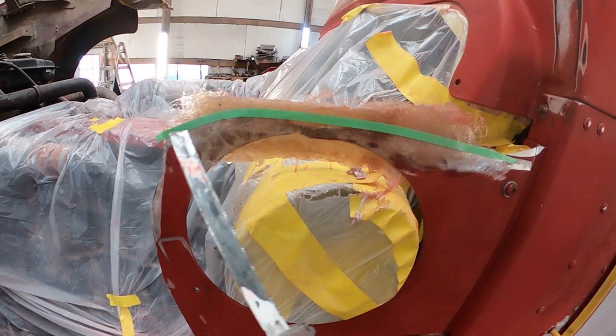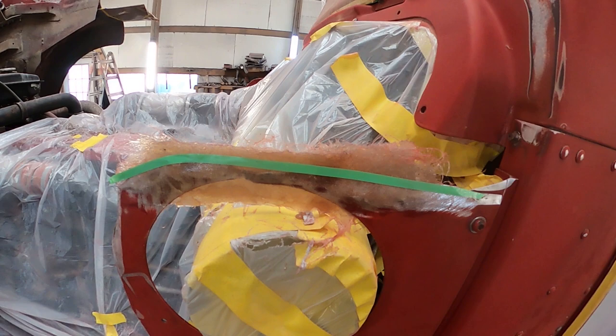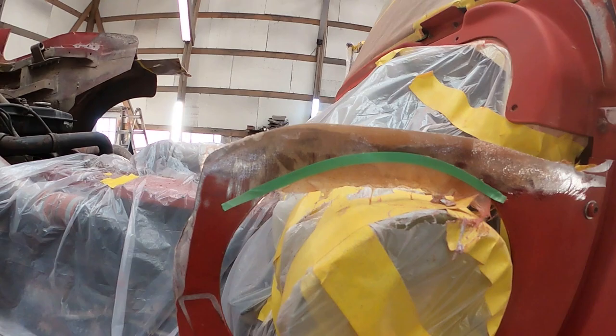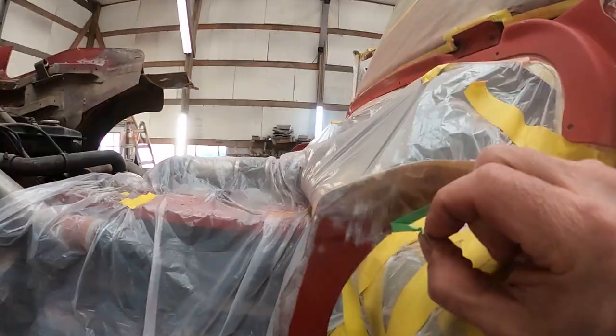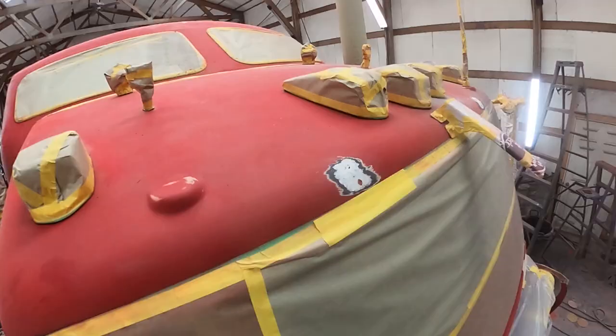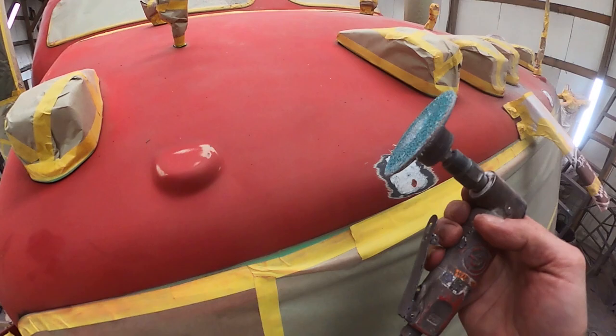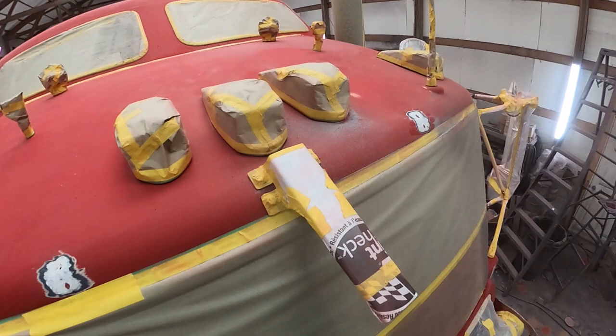What I've done here is just laid out a quarter-inch wide vinyl tape about where I want to cut this, so I can go along the tape — it's just a line that won't move and won't disappear within the dust I'm about to create — and I'll just cut it off that way. And here's the inside one — that looks decent enough. And up here on top of the cab, where the old visor was, they just had some silicone in there that wasn't holding; it's got a hole in the cab. So I just took this die grinder, ground all that out, ground it down about a sixteenth of an inch, did the same thing over here. That way I can put in some fiberglass patches and do bodywork over them.